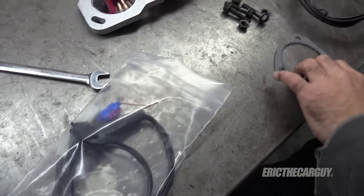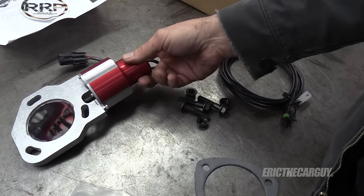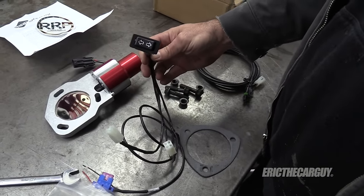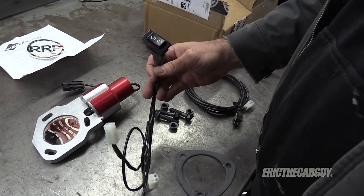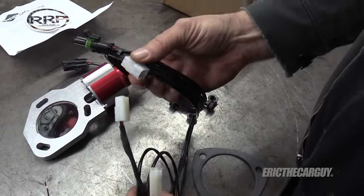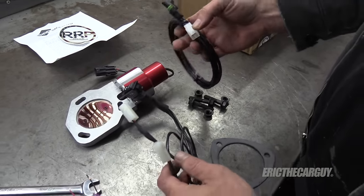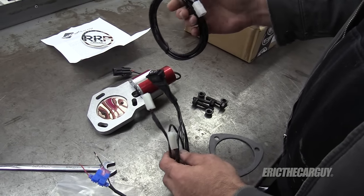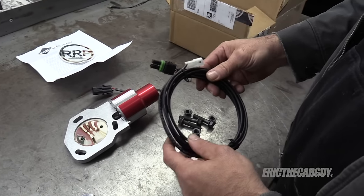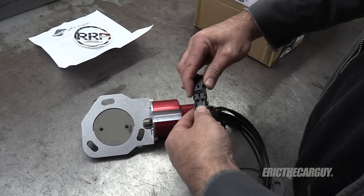This is what comes in the box: some new fasteners, wiring that goes down to the motor assembly, a switch assembly that looks extremely similar to the one I already have mounted in the dash, and a fuse. What I have in the dash already has a fuse. The setup looks like it's for a single unit, but if you had dual exhaust you could use the same switch for both cutouts. I'm only using one, so I'll probably just use this and splice in the connector to hook these two things up under the car.